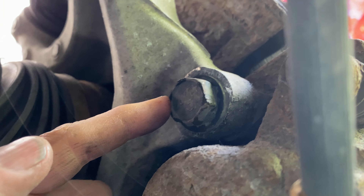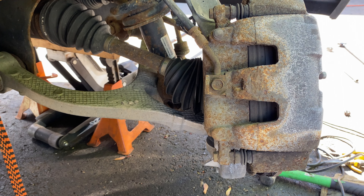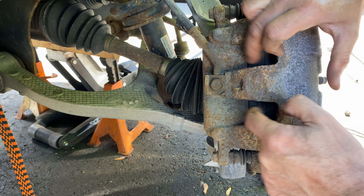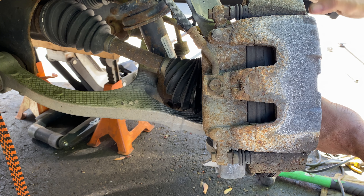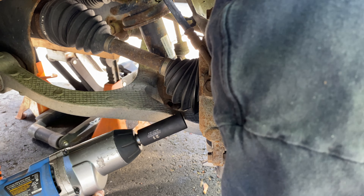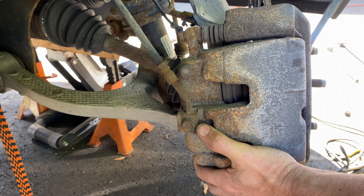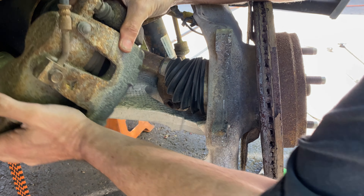Next, I'm going to take off the brake caliper. Remember to disconnect the ABS sensor — it's just a little clip, pry it out with a small screwdriver. That's loose, but I'm going to move the whole caliper over and tie it up. At the back we have two 21 millimeter bolts that need to come out. If your brake disc or rotor is really tight, you might want to lever the pistons back into the housing of the caliper. Mine is rotating freely — don't worry, it's just surface rust that's broken off. They're due for replacement soon as well, but we'll get to that another day.